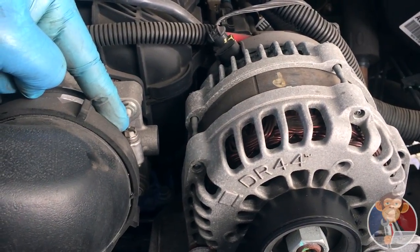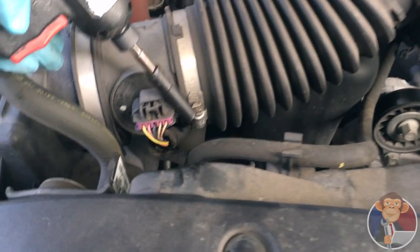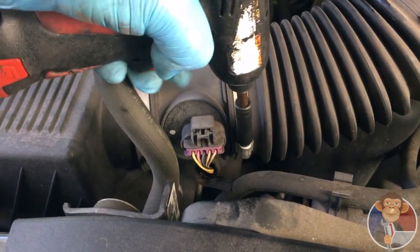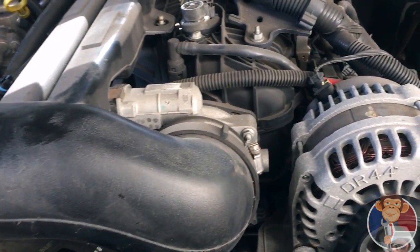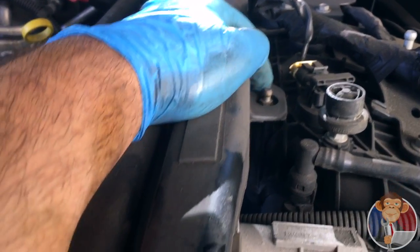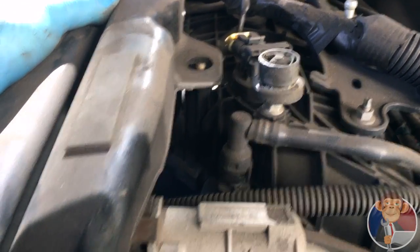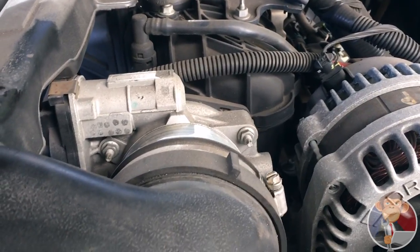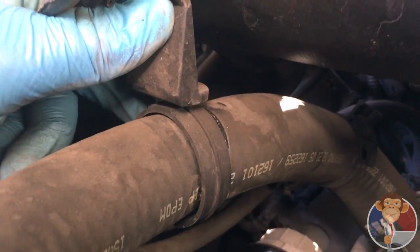There's an 8mm clamp right here and then another 8mm right there. I have my handy dandy drill here, so I'll do that real quick. You'll notice there's a little rivet here — it's supposed to be like a rubber grommet — and all you're going to do is pop it up, just like that, and then pull back nice and slowly. Once that's out, you have this side and then an attachment right here on this hose that you need to separate.